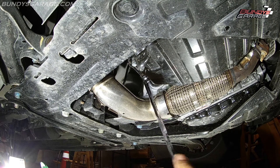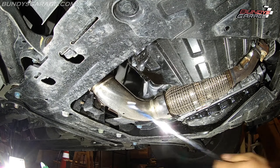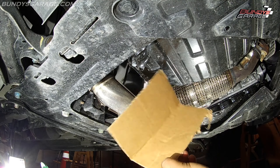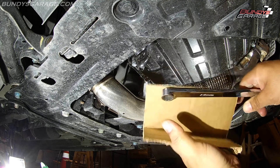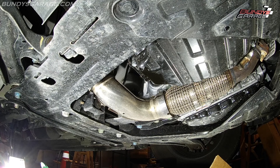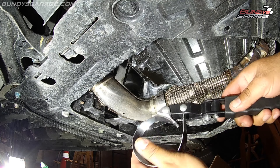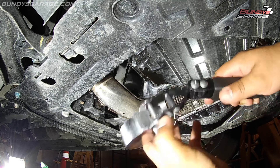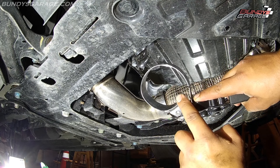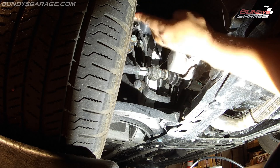This is a zero offset wrench — I've talked about these before and I love them, so I'll put a link in the description below where you can buy some on Amazon. That's all you need to do — you don't have to crank down on this thing. Right above the camera is the oil filter. I've got a piece of cardboard, about four to five inches, cut in half, and I'll put it into place when it starts to drain to guide the old oil out. Righty tighty, lefty loosey — depending on which way you have the oil filter wrench will decide which way loosens and which way tightens.